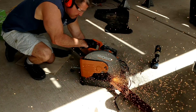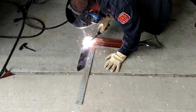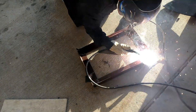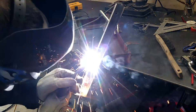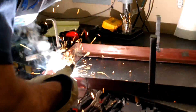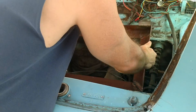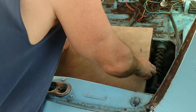After figuring out where to put all the batteries, it's time to start making the brackets that hold them in. There's a total of 45 individual lithium iron phosphate batteries wired together in series to give a total of around 150 volts. Had to be kind of creative to figure out where to put them. This is for the floor of the battery holders — kind of funny, it goes right where the old fuel tank went.